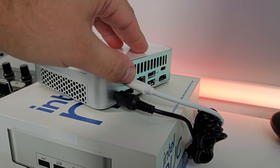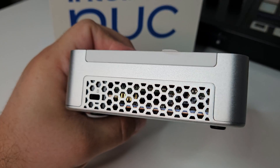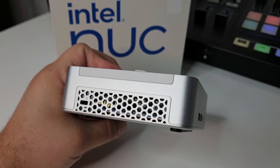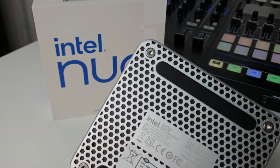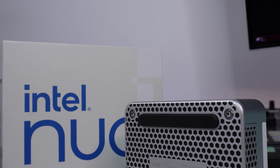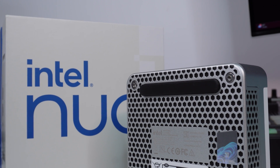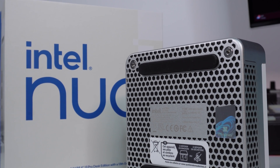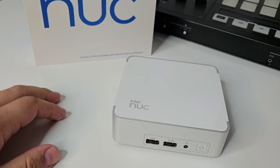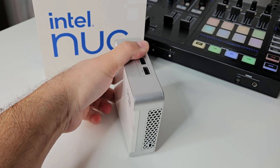When using the computer you can hear the fans working, and if you touch the chassis you can feel the relative warmth coming off the back where the exhaust vent is. The design is quite simple but elegant and functional — the side honeycomb shapes are actually holes that allow airflow to reach the heat sink. Even though this pattern continues on the bottom, those are not functional as they've been blocked off where the motherboard sits, since there's a whole lot crammed into such a small space.